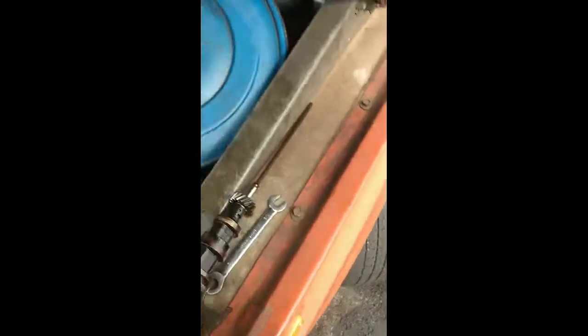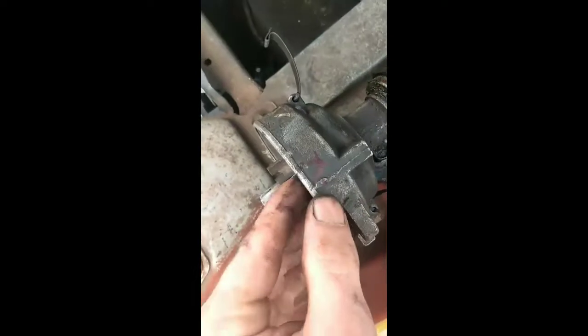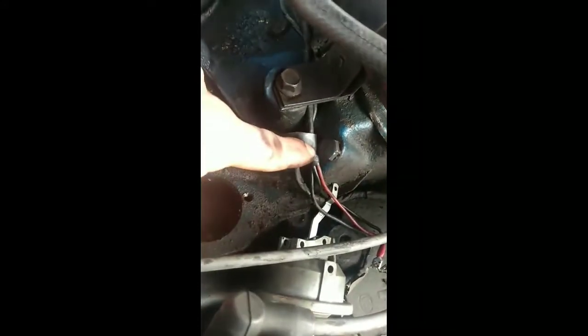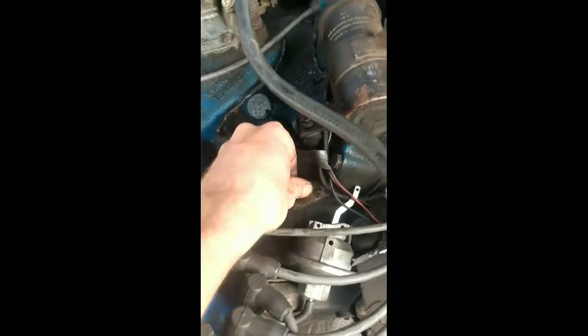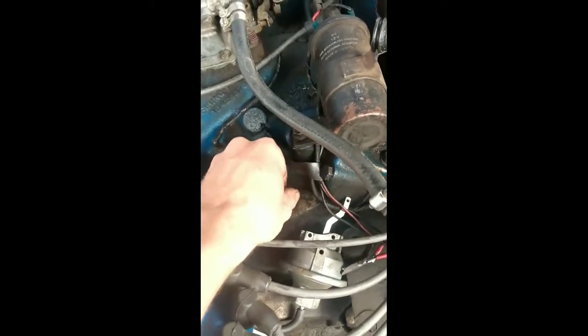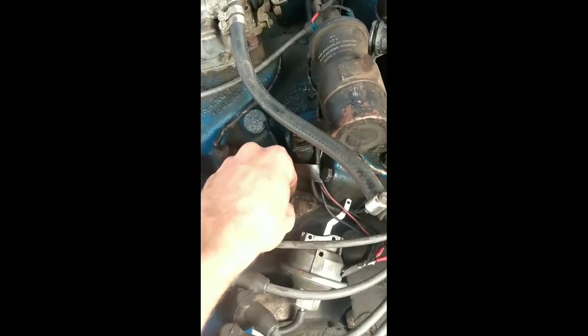Alright, well what I've done is I pulled this distributor up and out of the motor. But first, I went right here. Can you see that mark? That mark is in reference to that intake manifold bolt. That mark points at that bolt. And this beard right here points straight down at the distributor lock bolt hole. That's a 1/2 inch bolt on a hold down plate. That's what that is. It just goes right here. You can get it with a regular 1/2 inch wrench on these FE 390s. That's a 352, 360, 390. I think 408 or something like that.